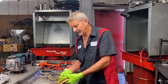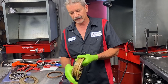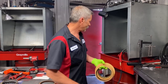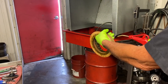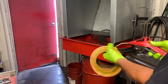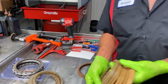One more thing, guys. When we get our clutches out of our kits, these clutches are nasty. Not nasty with dirt — they've got what we call clutch dust, clutch powder. So if you take this clutch and put it in the oil that you're going to soak them in, you're putting all that dust in your oil, and then you bring the clutch back out and put it right in your drum freshly soaked. We blow all of our clutches off and get that dust off of them because every one of them has got it on there.